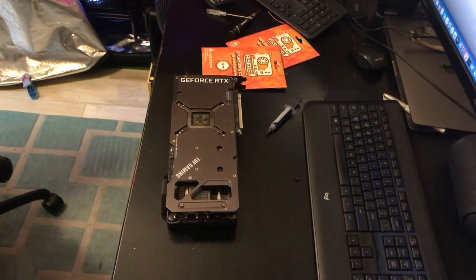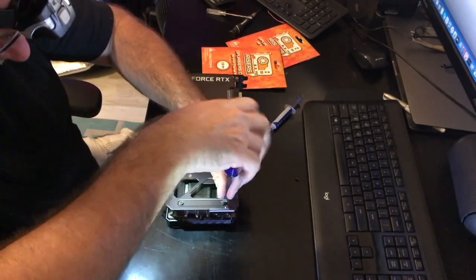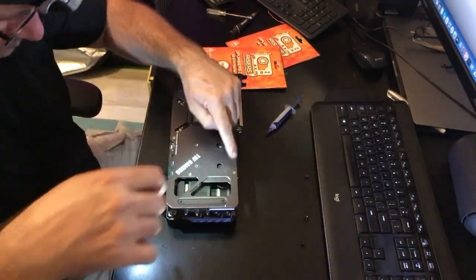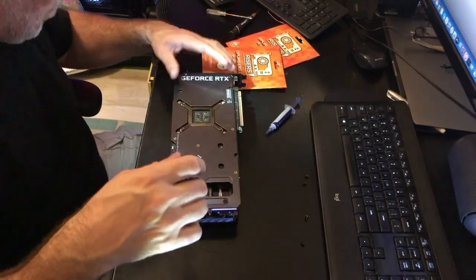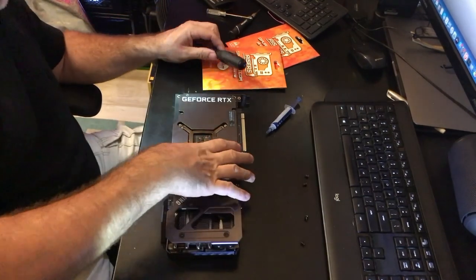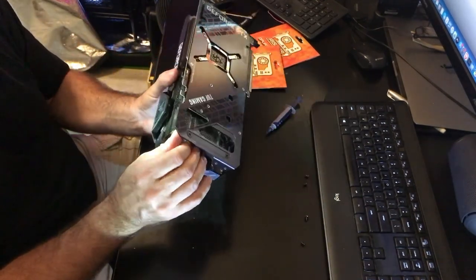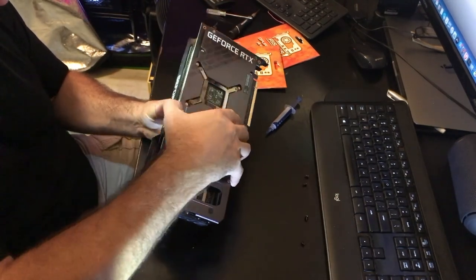Popping the back off to get to the chip and thermal pads, ripping those off, cleaning it, and putting it back together to see if it makes a difference. I'm doing a voiceover - it's just easier. Taking the screws out - do not drop the screws, they're hard to find. Checking what it's running a couple days later: it got to 106 at one point. The 3080 Ti's - after I swapped thermal pads I did notice a difference, colder temperatures, not those incredibly high red temperatures you see in T-Rex miner.